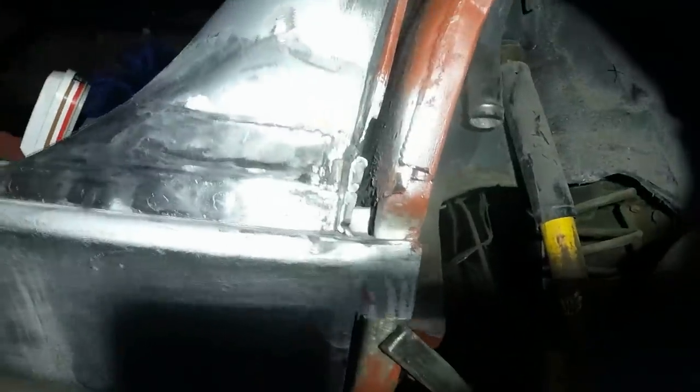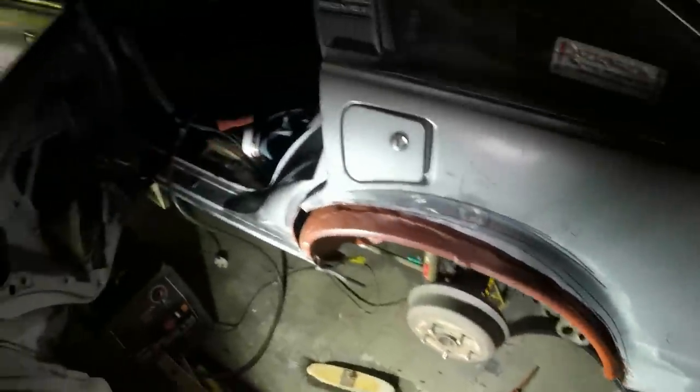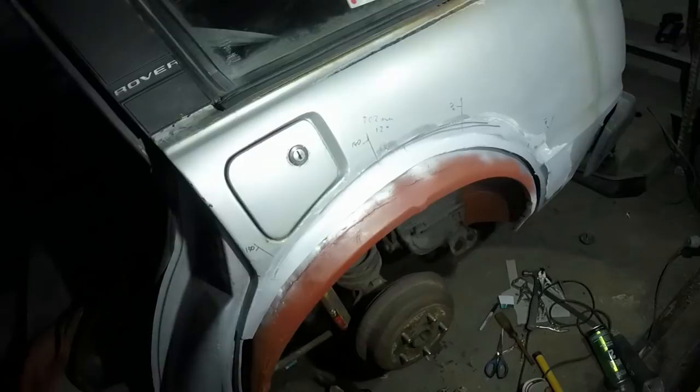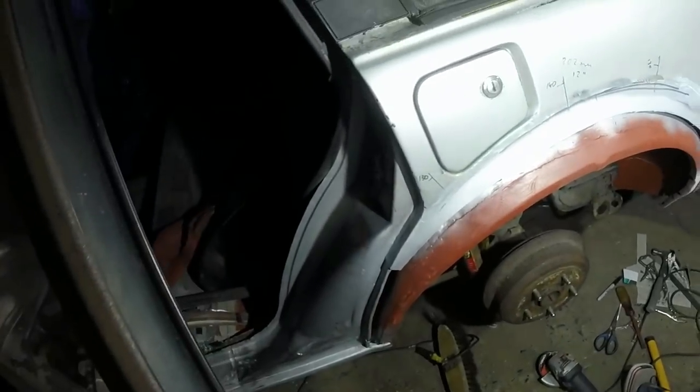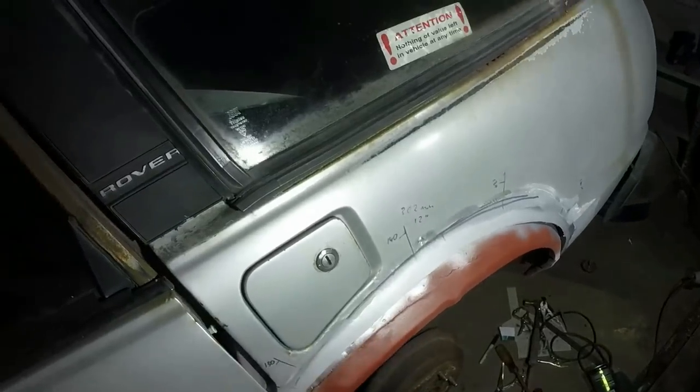That's welded in and cleaned up. Bit of filler and that'll all look factory original, solid, can't be moved, job's a good one. Now the fun final part, trying to put the bloody wing on. Just done a little bit more trimming to the wheel arch, taken all the paint off and then given it a coat of zinc primer. Worked the weld-through stuff in just because I won't be able to get to that to protect it afterwards.